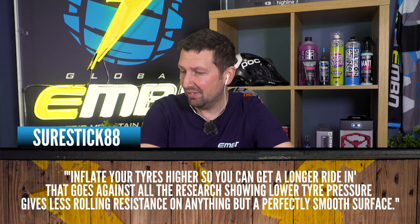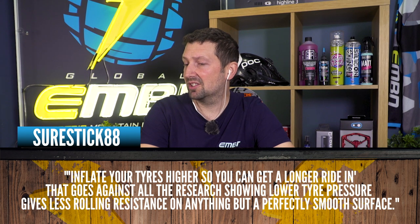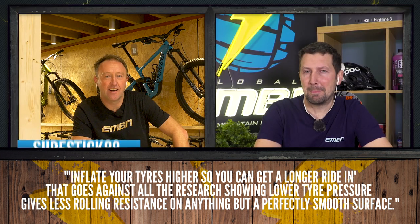We've also got a few more comments coming in on why you need the right tyres for your e-mountain bike. We've got a comment in here from Shorestick saying, inflate your tires higher so you can get a longer ride in. That goes against all the research showing lower tire pressure, to a point, gives less rolling resistance on anything but a perfectly smooth surface. Yeah, I think that's an interesting comment, isn't it, really?